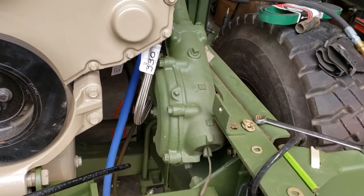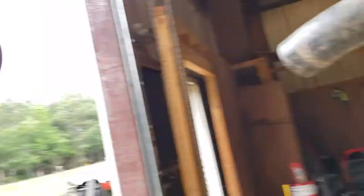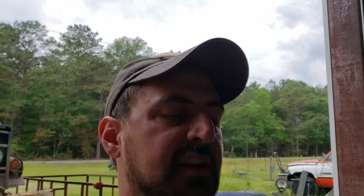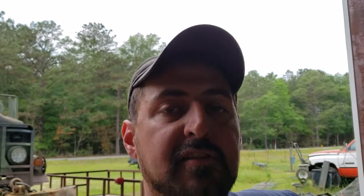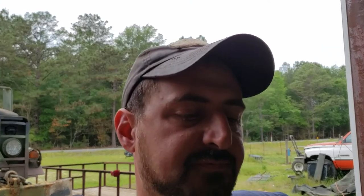Take care of your box — it's the next most important thing to your brakes. If that steering goes out, you're going to kill yourself or somebody else. It's a good idea to upgrade to hydraulic power steering if you've got the money. waterloospecialties.com — Tom sells a power steering kit for these trucks. It's not cheap; I think it's $2,650 or something, but it is absolutely everything: the entire kit, free shipping. For the multi-fuel engine you get the pump, the adapter, the gear, all the lines, the steering box, all the hardware, the reservoir — everything. It's a ready-to-go kit. All you've got to do is throw it on, well, you've got to drill some holes in the frame, but it's a whole lot safer than this old manual steering setup. So give that a thought — it's well worth your time and it makes the truck a lot more drivable too.